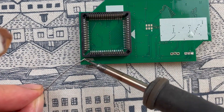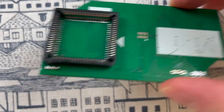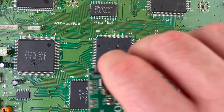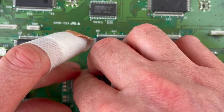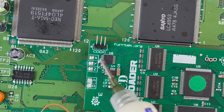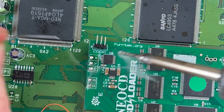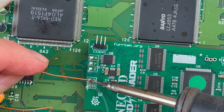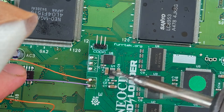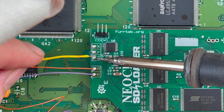I need to move the CD connector which I've already desoldered and moved across to the other position, tacking it in from behind to make sure it has a good connection. To attach the mod board, you need to line the arrow on the socket up with number one on the CPU to make sure it's in the right orientation, then push down very firmly making sure all the CPU pins are making contact. We apply flux and tin up the pads, then connect the wires: pad A goes to the pad underneath the lifted pin on the master chip, pad B goes to the lifted pin itself, and pads X, Y and Z go to the pins on the underside of the motherboard which connect to the CD audio.